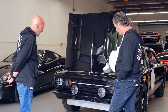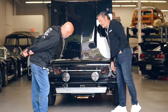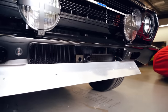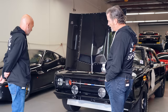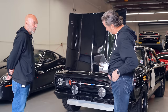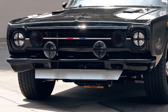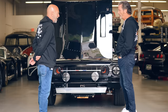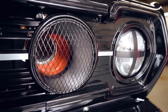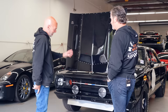Did you make the chin spoiler too? Yeah. And those things that look like parking sensors are actually the turn indicators — just little LEDs on the front. The stock bumper is cut into about nine different pieces to make it more of a valence: narrowed, pulled up for that angle on the outside, and functional — it draws air up from the chin spoiler directly into the radiator. Even the grilles are a rock protector from a Harley-Davidson. I designed it all to fit together, and it worked.